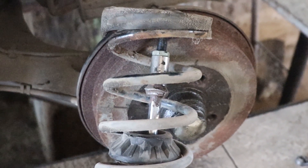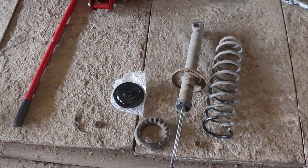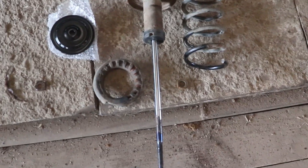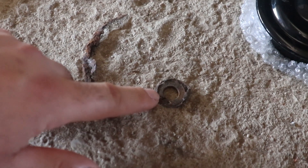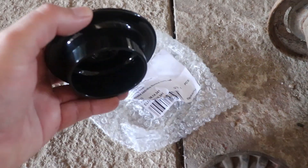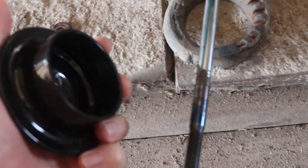At the end of the video I can at least show you what the new part looks like compared to what I disassembled. You can see the spring here, and the shock absorber is fully disassembled. This is the new part, and this is what I took off the car — these two pieces were all that was left. This is the way it's supposed to look. It mounts on top of the shock absorber like this and holds the spring in place.